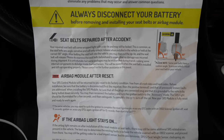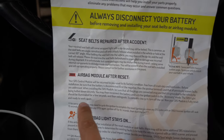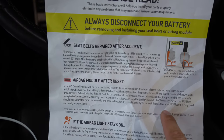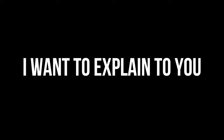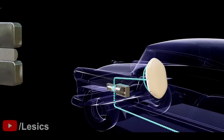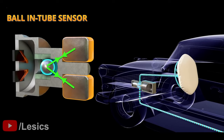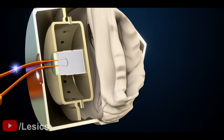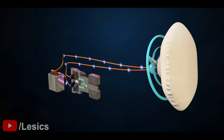The instructions say to reconnect the battery — which we just did — and then turn the ignition to accessory mode. The SRS light should illuminate for a few seconds and then extinguish. To complete the cycle, turn off the car. Before I show you what happens, I want to explain what's going through my head. Besides airbags and seatbelts in your SRS system, you have things called impact sensors — a little sensor on the front of the car with a metal ball held back by magnets. During a crash, the extreme stopping force pushes the ball forward and completes the circuit, immediately telling the airbags to deploy. As far as I know, these are reusable sensors because I never changed them, so fingers crossed nothing happens.